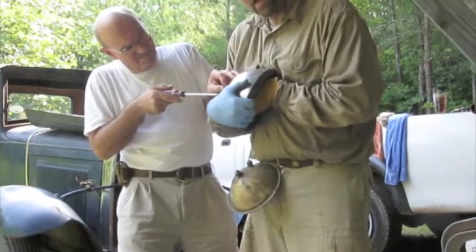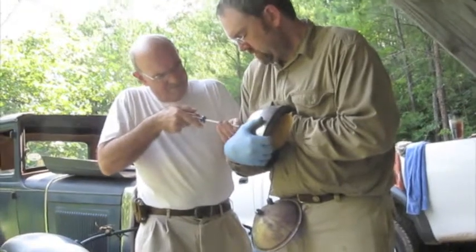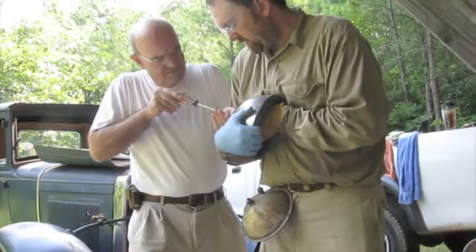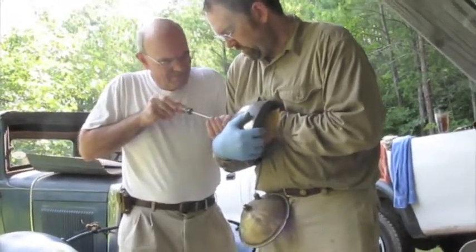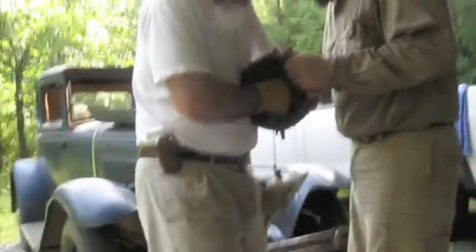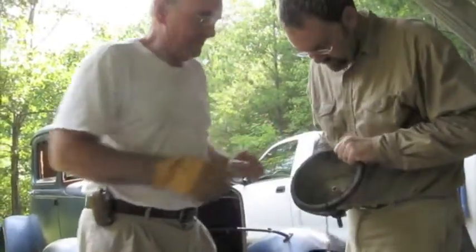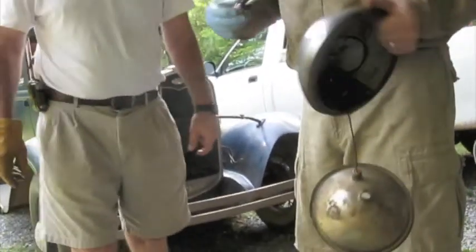And so we're loading up the spring on the focusing spring on the main headlight socket. We definitely need two people for this. As you can see, one person's got to push in, hold the bowl, and then the other person's got to thread the focusing screw. And so you got the whole thing in there, thread it. You got to have two people. Alright, release. Okay. So the thread's in there. So the socket set up, and you can adjust it with the back screw.